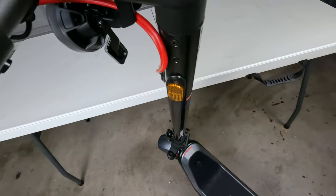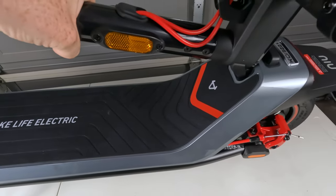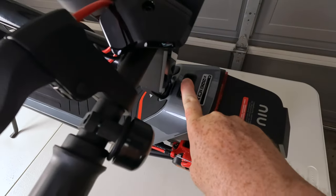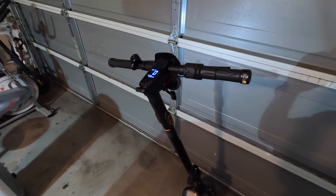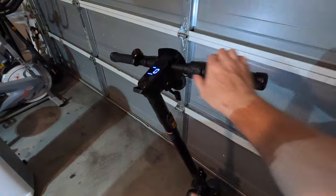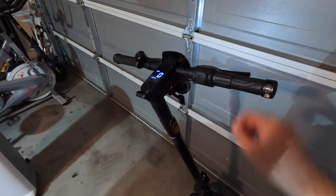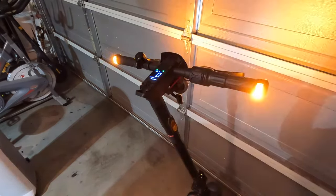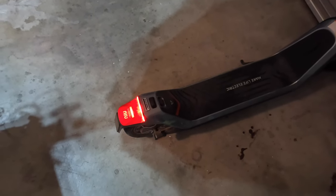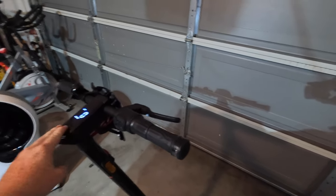If you're curious what the latching mechanism looks like, it drops right into place — super precise — and now you can pick this thing up and walk around with it. When you want to unfold it, you just push the button and lift to unlock. The turn signals have lights on the rear and front of the handlebar. You click again to stop, and if you want to activate the hazard lights just double-click. When you pull the brake lever the light gets brighter, which is always nice especially when riding at night.